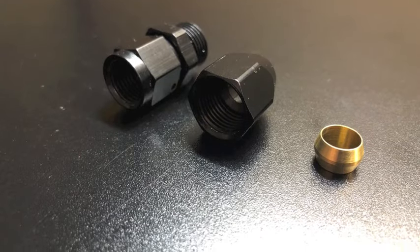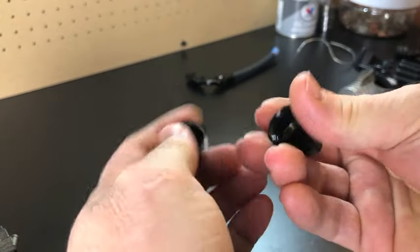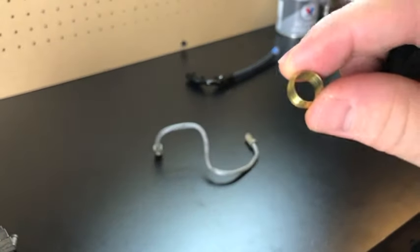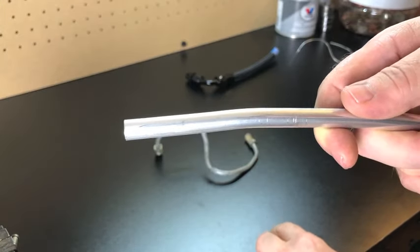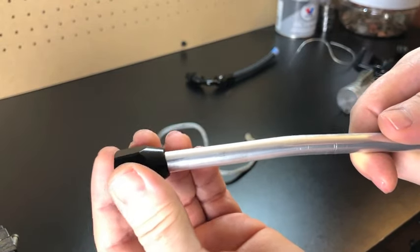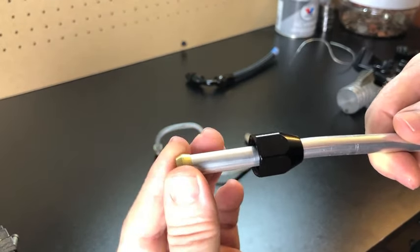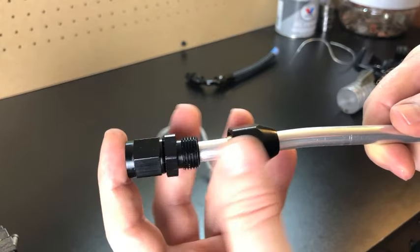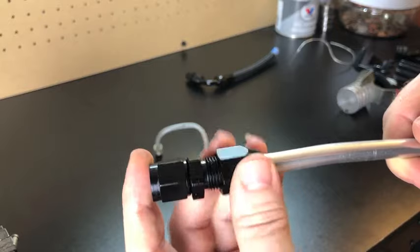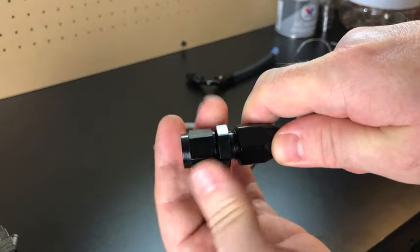Here's a look at one of the compression fittings — it comes in several pieces. Inside is a compression sleeve; this sleeve compresses down on the line when you tighten it all down. To put it together, you want to put the first part of the fitting on with the threaded side out, then the sleeve over the line, then add the last part of the fitting. When these two are tightened it will compress the fitting to the line. I did not use this on the fuel lines, but I have used this before on the transmission line and it worked out pretty good.